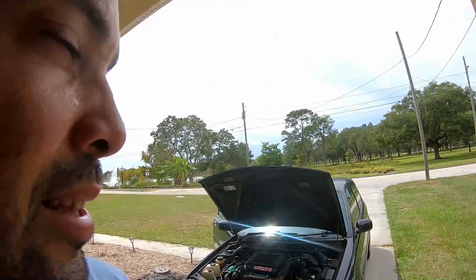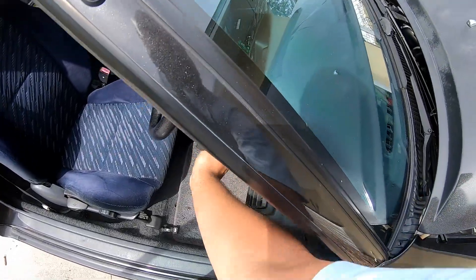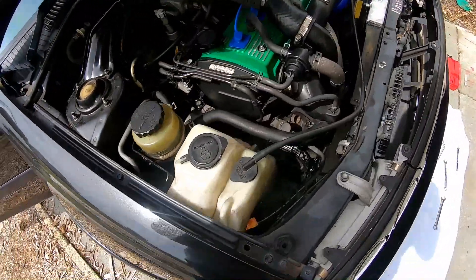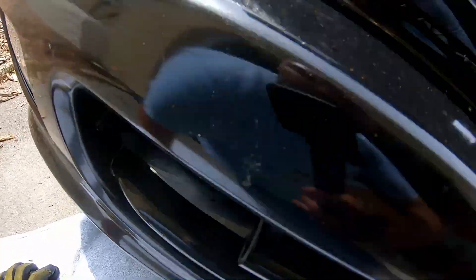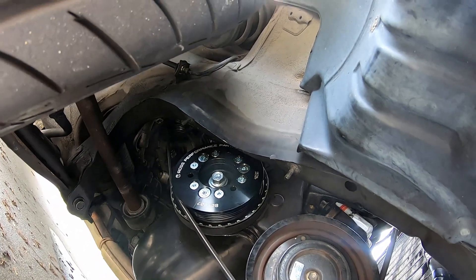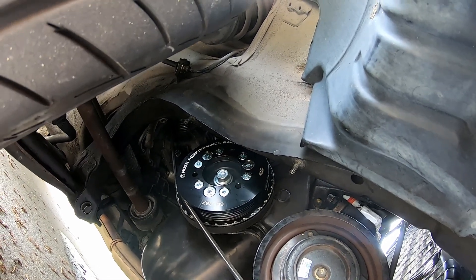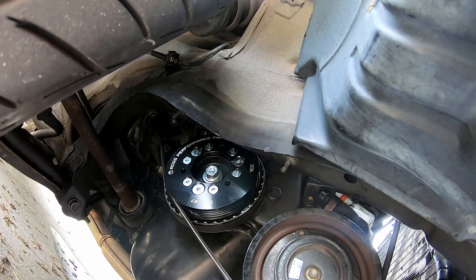The instructions say to run it up to about 4,000 RPM and then readjust your tensioning. If you look at the manual for a 4E FTE or any other Toyota from that era, they have a little tool that I'm just not going to waste my time buying. It's a pretty straightforward install — you basically want to remove your belts and loosen up all the tension, then lift the car and start taking off your pulley. You'll need a pulley puller to remove it and a pulley installer to install it. That's how you get to this finishing moment, with this nice new metal jacket harmonic damper on.